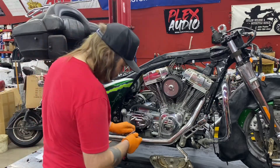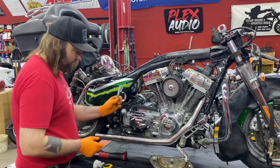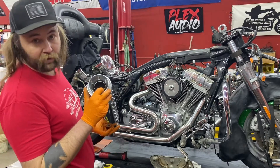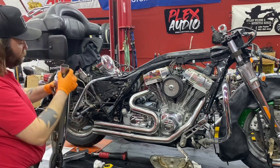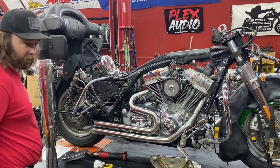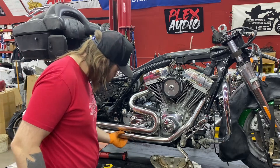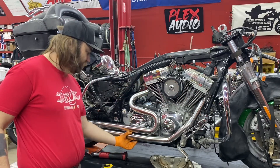We're installing our head pipes loose first. Now that you've got your front head pipe on, we're going to install this two-inch P-clamp — don't tighten it up yet so the pipe can still float while we get everything tightened up as one. This is the muffler from Red Thunder. We're going to take the DB killer out so it flows as much as it can. With the DB killer installed it'll meet noise emissions all over Europe. Tighten up your muffler clamp, then tighten up front head nuts, rear ones, and then tighten up the P-clamp last.